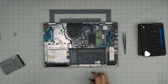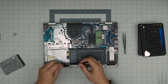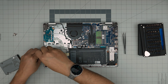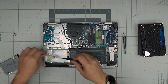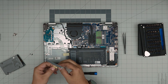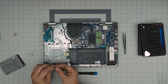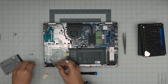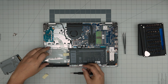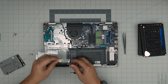Now to remove and upgrade the 2.5-inch bay, first we need to remove the caddy. Remove three screws — two in the front of the caddy and one screw at the back. These are tiny screws. Once you remove them, lift up the caddy. You'll see the screws on the side, which can come out completely — you're going to use those. The tape on the caddy you can just fold aside; you don't need that tape.